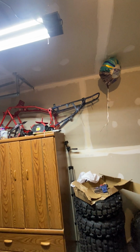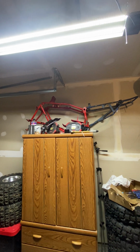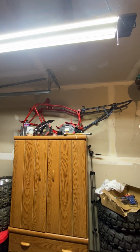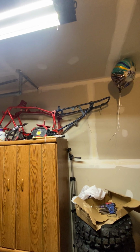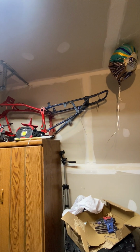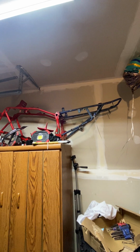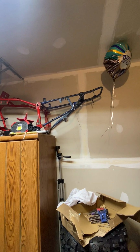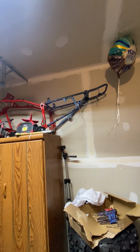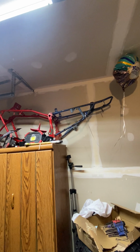I know it's definitely gonna have a Walsh. I'm gonna get a Walsh swing arm for it, for sure. I got one in my cart, and man, it's gonna be sick. Man, the 06 Walsh swing arms work on the 400EXs. Well, 06 TRX 450R swing arms work on the 400EXs, just in general. LSR, I think, makes them, and Walsh makes them. And I don't think Roll Design makes swing arms anymore for right now.